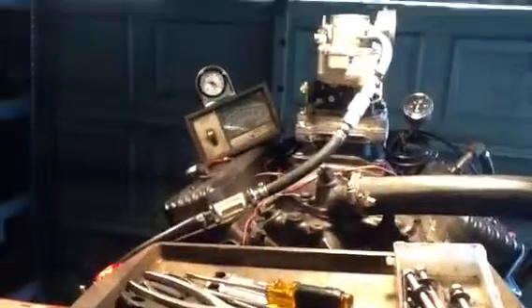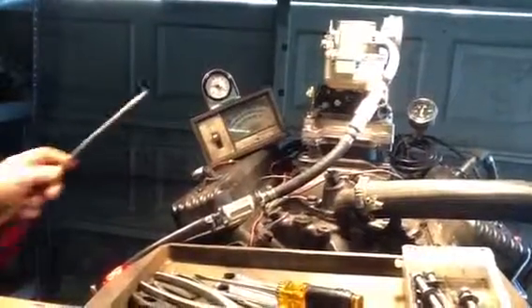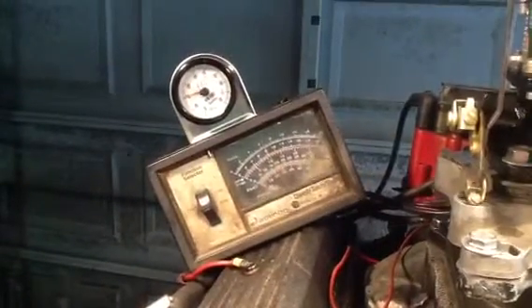We're running on three pounds of pressure over here, and now we've got it up to 12. As you can see, there's no variation — that means the internal part of that carburetor is okay for ethanol fuel. We got it converted over; we had to make some major changes, but it's done and it works good.